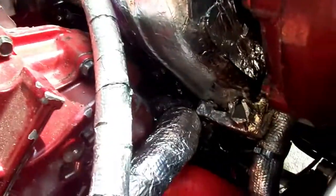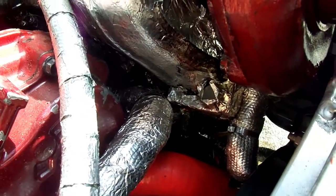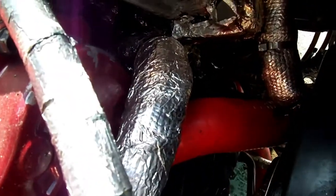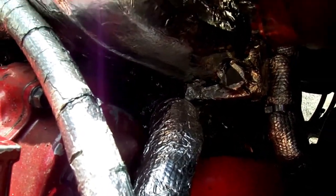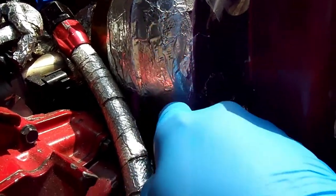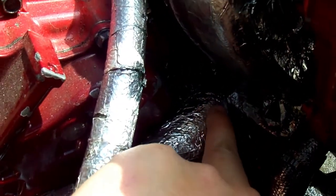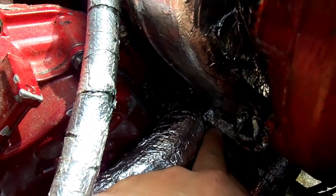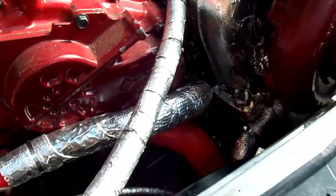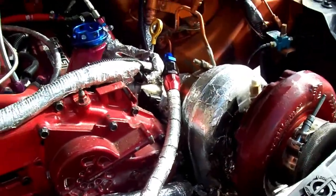We have two locations that were a problem - something I should have been cautious about. The problem is the heat right here. Obviously you can put a turbo blanket on top of it, but the bottom right there is where it melted the crossover radiator hose. It was touching right here. The new one I installed has the heat shield covered, so it should be handled solid.